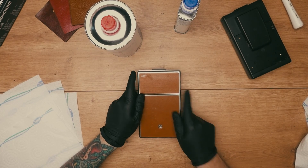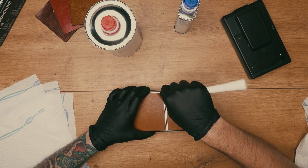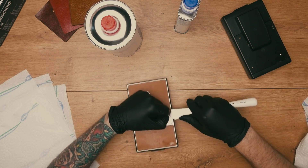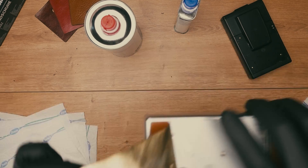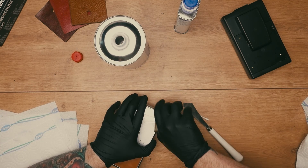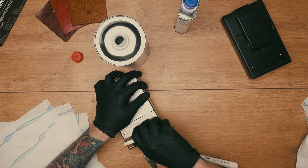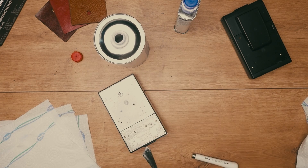This camera is a little different — the leather is on kind of an aluminum foil. This golden foil is pretty tough. You can see me working on it and it takes quite some force to get it off. But as soon as you start, you can bend the first edge and start cutting off the glue — just go through it with the knife and the glue starts to cut. You can peel it off slowly by going through with the knife. This glue is sticky — it actually ripped off my glove when I tried. We just continue and rip off that last piece and now we are at the top of the camera. First thing is done — we have the bottom of the camera with the leather removed.